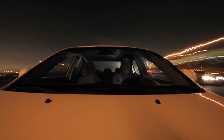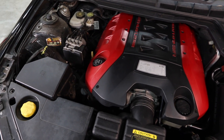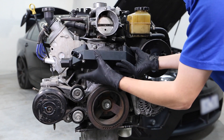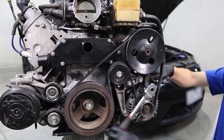Step 17. Road test vehicle for at least 10 kilometers. Return and allow to cool down. Recheck the coolant level and recheck radiator hose connections. This advanced Davies Craig EWP block adapter allows LS owners to enjoy superior engine cooling technology using Davies Craig electric water pump EWP and the LCD EWP fan controller combo pack.